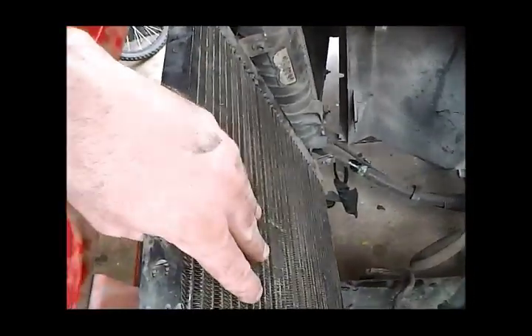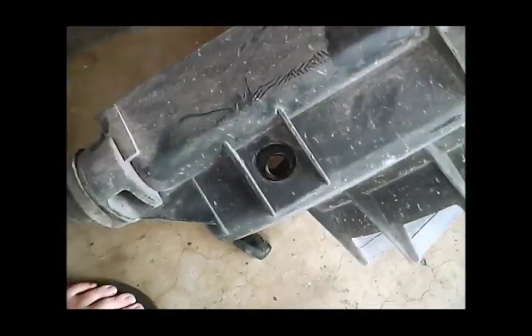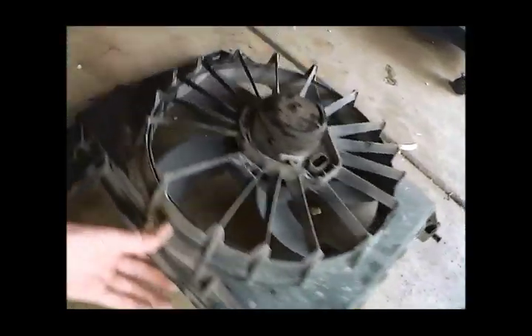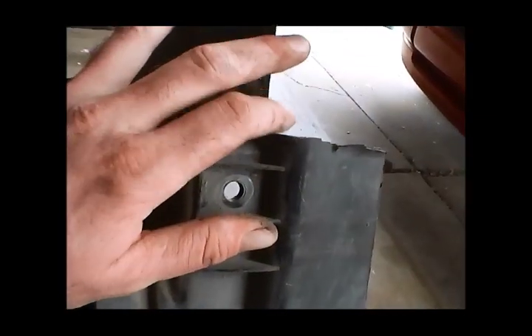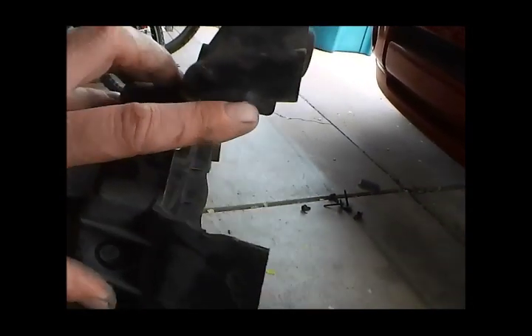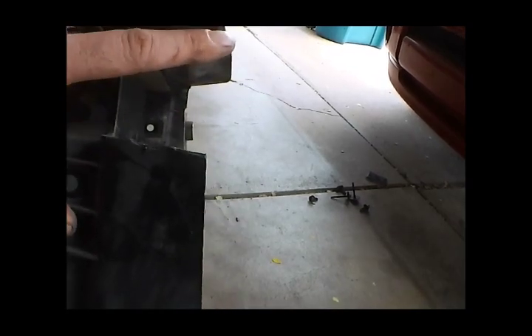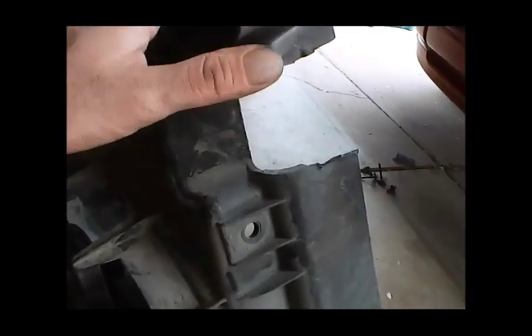When you take the condenser fan off the condenser, there are four bolts — two attach to the firewall and then there are four bolts on the side that attach the condenser to the fan. To get the condenser out, up on the top right there, there's a spot where the plastic only has an opening just for the hose. What you have to do is use a pair of dikes and cut it right here. When you get the new one, use a die grinder or a saw and saw it across. This one is junk so I don't have to worry about damaging the shroud, but you have to do that or the hose won't come out.